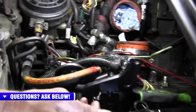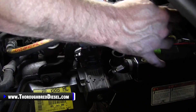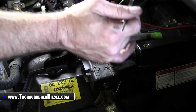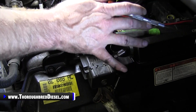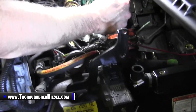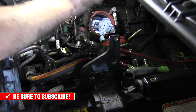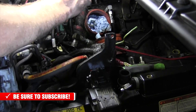You're also going to get some PCV residue coming out of the PCV valve — that's going to have some moisture around this area right here. If you've just got a little bit of moisture right there and you don't have an external leak and you're not leaving a spot in the driveway, you're probably okay. But you always want to look in the engine valley as a collection point for leaking oil. If you see pooling oil in the engine valley, you have an engine oil leak.